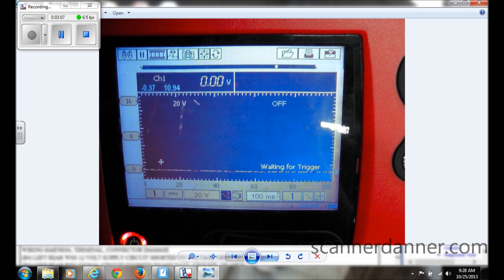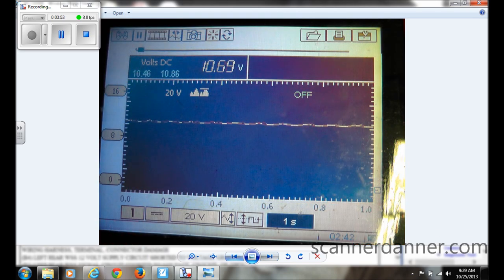What we were looking for on the wire that read zero was an expected signal, and we did not see one. So before doing a lot of homework, we went to the right rear to compare a known good sensor. We know we have a signal on the right rear because the scan data shows a mph reading. On the feed wire, while spinning the wheel, we see very small oscillations.